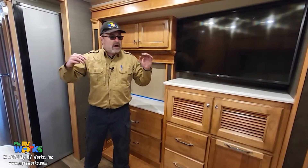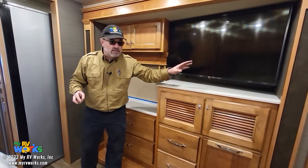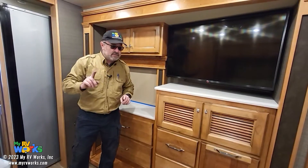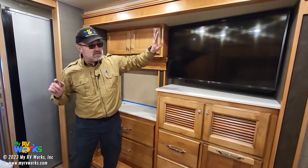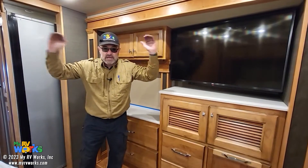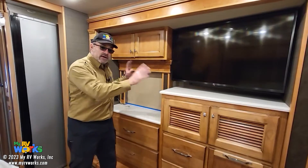Where you're getting into trouble is when these rooms get out of synchronization. Maybe you stopped somewhere and just opened it a little bit to get into a drawer for your socks, then closed it back. The room never fully cycled. The other reason it might get out of sync is as soon as you take your finger off the button, because you decided it was open or closed all the way. My rule of thumb: keep your finger on the button, count to three or five — let the controller stop the slide room.